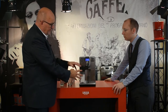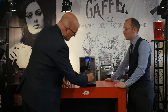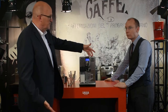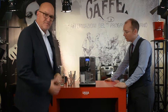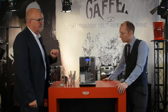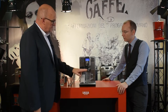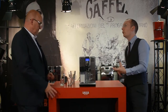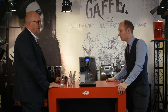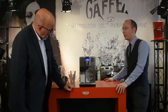The whole black head comes off to fill the carafe, or if you think you're running out of milk you can just take the case off and add a bit more. We pop in a nice large cup with good clearance, the head comes down as usual, and as said this is the one-touch cappuccino - we're literally pushing one button. It checks you're in the right position, grinds about nine grams of coffee beans, then heats the boiler to dispense milk and espresso straight into the cup together - all from one button.